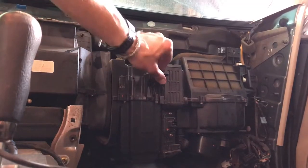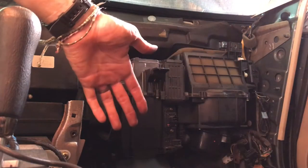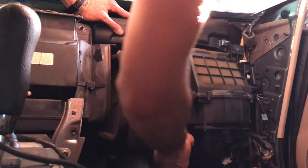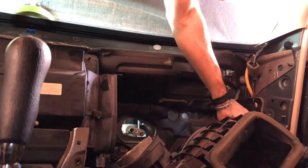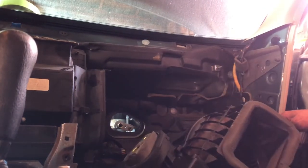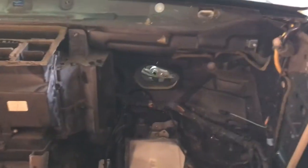There she is. I was trying to get this AC box out of here and I was missing one bolt on the lower right, kind of behind that wiring harness. So if you can't get something out, look for a missing bolt — there's more than likely something there. I think this thing is ready to come out. I'm not cutting a wire, just cutting a little plastic piece that's holding it on. It's always the last ones that give you the biggest trouble.